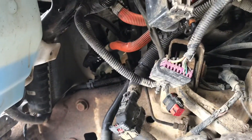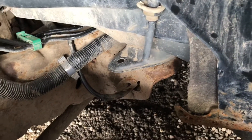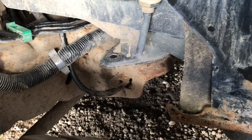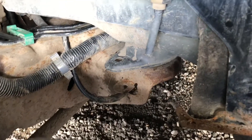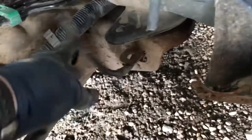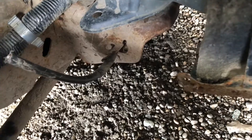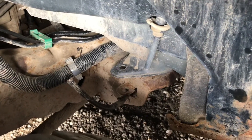There's one thing I didn't show on the disassembly — the parking brake cable that I never did pull apart. I was lifting on the cab and finally noticed I hadn't done that, so I just took the saws-all and cut it in half. It's an automatic truck and the cable was seized up anyway, so it's not a big deal. If I decide to fix it, I'll stick this little grommet back in there to plug it up and keep moisture out. I'll saws-all it a little shorter so it's not going to rub on the tire. Park brake's not that important on an automatic in my opinion, but not a big deal to fix should I decide to.